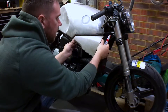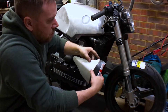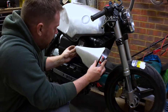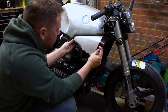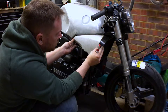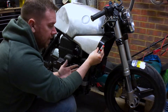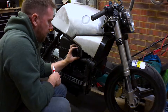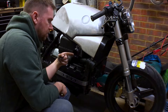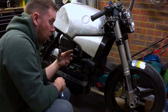One thing I'm noticing is this top part here — where I've moved the tank back slightly, the top part is actually just touching the front of the tank. I'm not too sure why it's doing that, because this isn't bolted on anywhere else. So I'm just going to take the edge off of that. Also, here you can see the issue with the air filter. This is the air filter housing, and once you put a pod filter on this, you're talking probably at least four inches out from the bike.